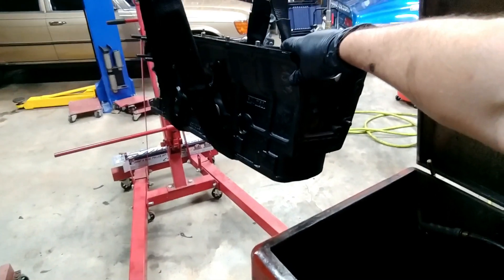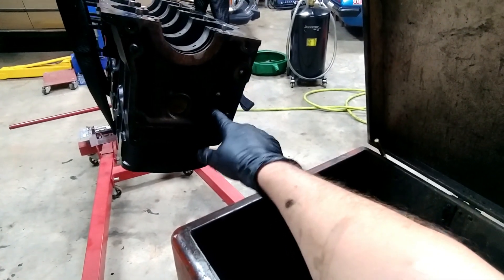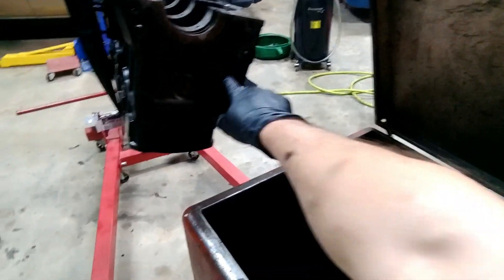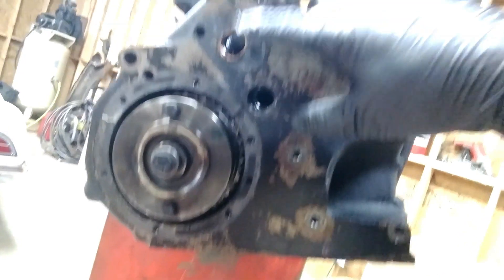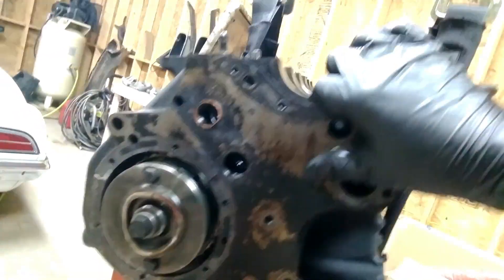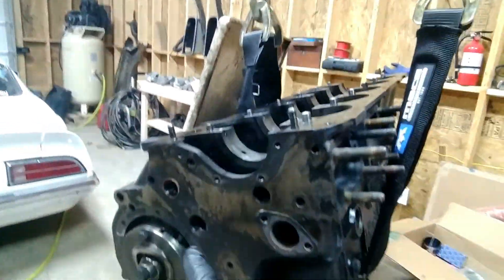See these two? They're steel balls — they plug up the oil galleries or oil passages. Here are the two main oil passages, there's one and there's one, and those go all the way through the engine block. If you shot a light into the main bearing holes you can see the light down in the oil passage.